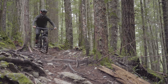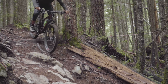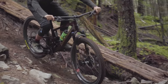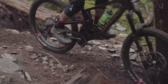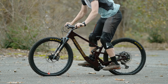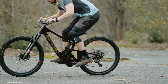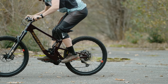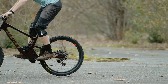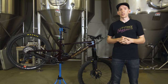The current version still has 27.5-inch wheels and 170 millimeters of travel front and rear. Refinement is the name of the game here — it's not a radical revision, more of an update to keep this bike up to speed and maintain its all-mountain prowess. This bike still uses Santa Cruz's VPP suspension layout, the dual counter-rotating link design they've been using for years. This version has received a longer stroke shock compared to the previous version and a tweak to the leverage curve, made a little straighter so it stays consistent throughout all 170 millimeters of travel.